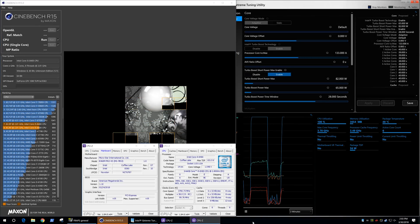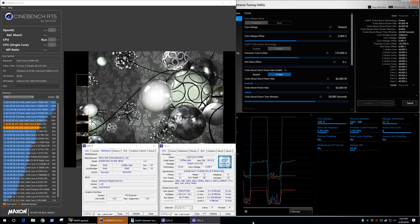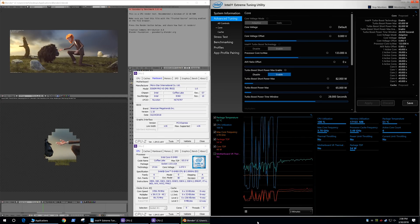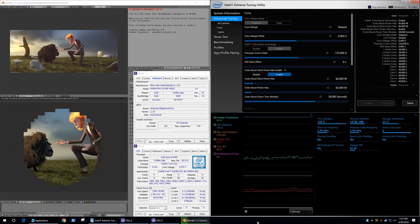What about a CPU you're more likely to pair with a budget board, something like a Core i5-8400? Without making any alterations to the B360 Pro VD's configuration, the Core i5-8400 scores 877 points on its fourth pass, which is on par with what we saw from the Z370 Godlike. That's great news. Firing up Blender with the 65W package TDP ceiling, the 8400 left us with room to spare — every now and then peaking at just 62 watts. For the entire test, which ran for over an hour, the 8400 held a constant 3.8 GHz without flinching for a second. The Gamax 200T kept the CPU very cool at under 60 degrees and we never saw any kind of throttling. You won't see throttling with the Intel box cooler either on the 8400. The maximum package TDP of 65W is sufficient for getting the most out of the Core i5-8400.